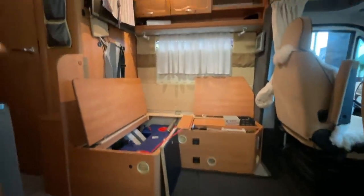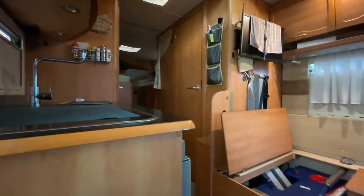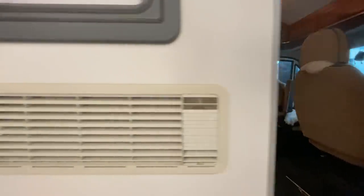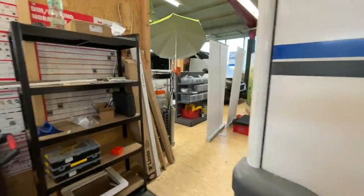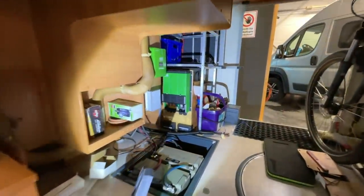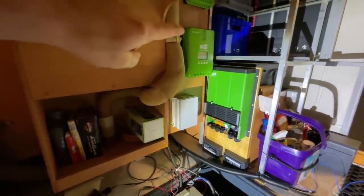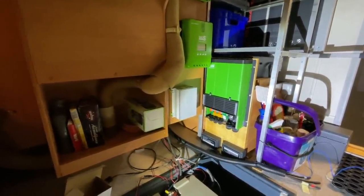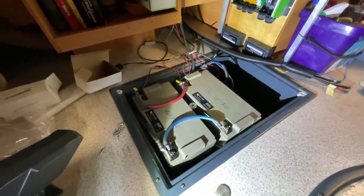This looks really great. The motorhome itself is still really stylish. Let me give you a quick look around. Some additional sockets will also be installed. And now let's go to the highlight — what we're putting in. We almost need to approach from the other side to see it better. Ta-da! Here's what we've installed: solar controller, charge booster, and then our combination unit. We've pre-positioned these here already so we know how to arrange them all. Because two new lithium batteries are going in here — we're doing two times 150 amp-hours.